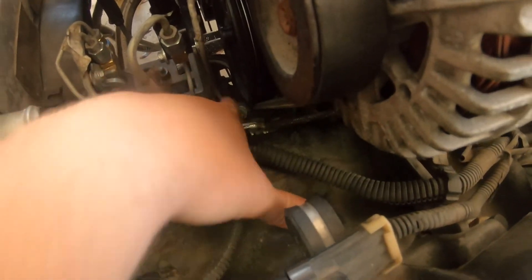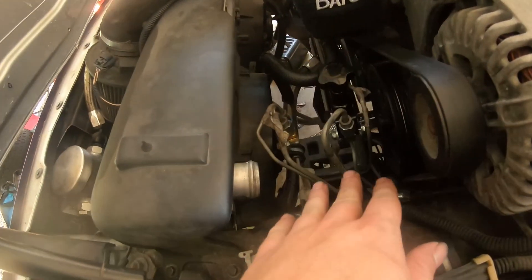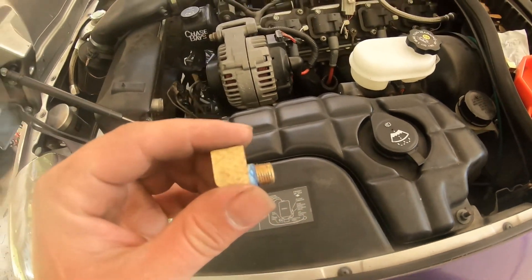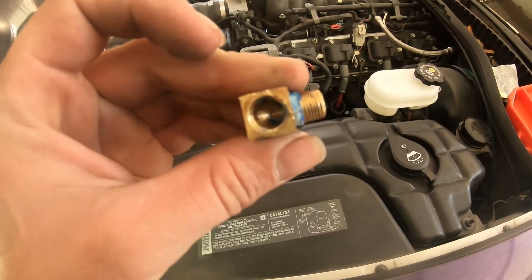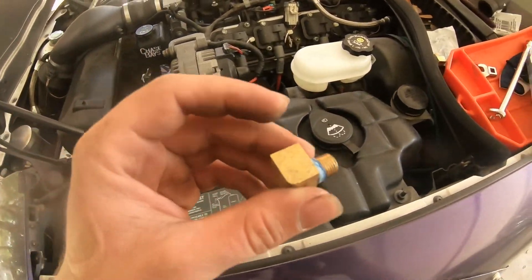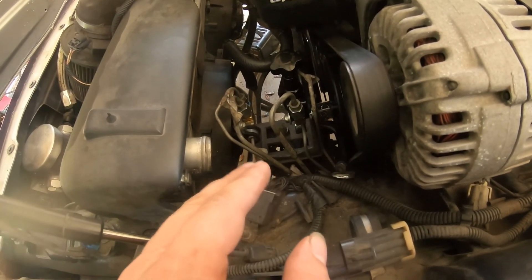Now that the lines are all secured, one thing to note: when tightening these up they can twist, so watch that they don't get close to the belt. The brakes are bled, but while bleeding I had a leak — one of the street 90s cracked because I tightened it too tight. These can be overtightened and will crack and leak, so do not tighten them too tight. I bought a replacement from O'Reilly's.